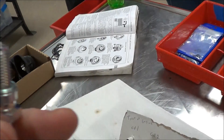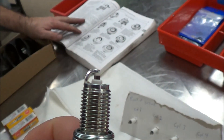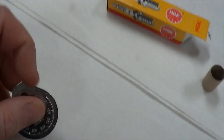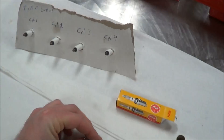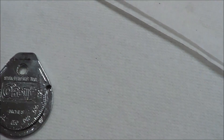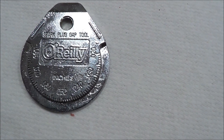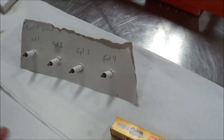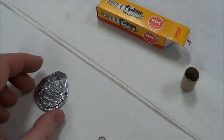Let me get a close-up here. So what you notice about this ramp-style tool is that it's a ramp — really thin on one end, getting thicker and thicker. It looks like it goes from 20 thousandths up to 80. These are really cheap — like a couple bucks. A lot of guys have these on their keychains. They're fairly accurate, really, but we're going to talk about when not to use them.